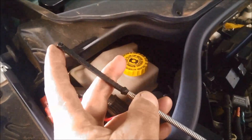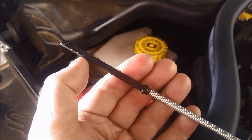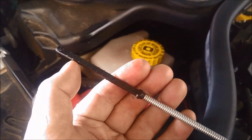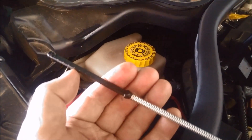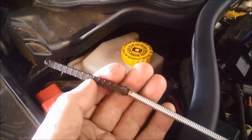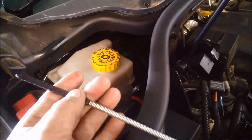What we're doing is we're letting it bottom out and we're going to measure: 10mm will be the low 25-degree mark, and 20mm from the bottom will be the high 25-degree mark. We'll also mark the 80-degree mark as well. We just poke that down there and you'll see how far it goes down. This is the 1200mm dipstick — you can see it doesn't go all the way in. So we've actually got to measure on it and just make sure we get those marks at 25 degrees, with the bottom at 80 degrees.